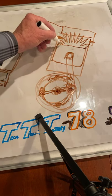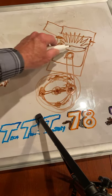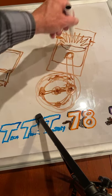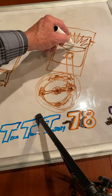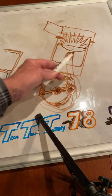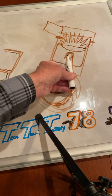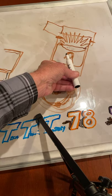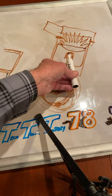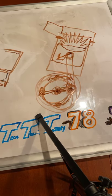And it tries to melt the piston. It tries to overheat the rings. And what this is doing right here is this piston's going down and this rod's going this way. This piston right now, this big stress, because this is turning, y'all. This crankshaft is rotating and this rod is going down. Watch this. This rod is going down and this pressure right here is trying to shove this piston through the back of the cylinder wall.